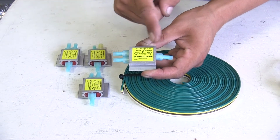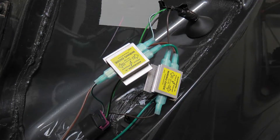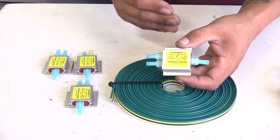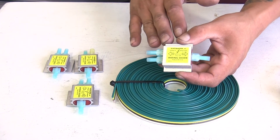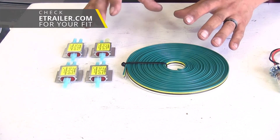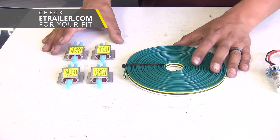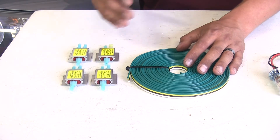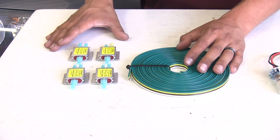All of our lighting functions are going to go to our factory bulb, and the diodes themselves are also going to protect our factory wiring from any kind of back feeding or any other kind of issues that may arise on the motorhome end. Our diode kits are available in several different configurations, from what you see here all the way to containing everything you need, including the plug as well as the umbilical to get everything in place.